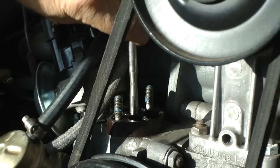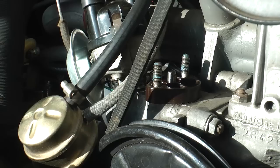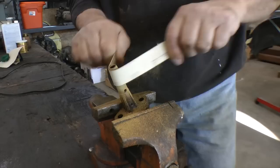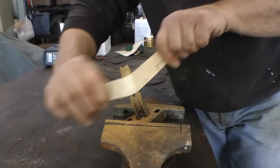If you let it go and it gets stuck midway down the threads, this could be your problem. What happens is you see this pin that goes into the stand and then gets pushed up into the fuel pump as the car is running. As the car is getting warm and gets hot, that stem that's inside the block will hold that rod and basically starve the car from fuel, putting it into a vapor lock mode.